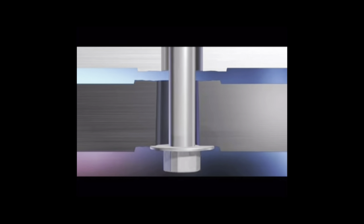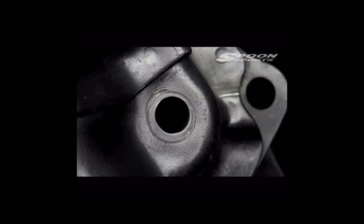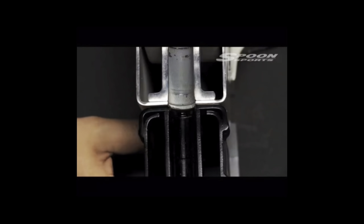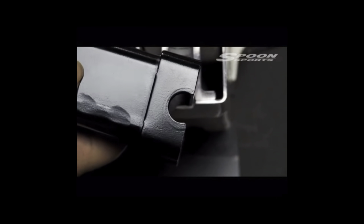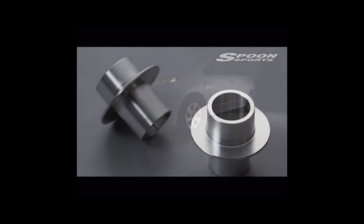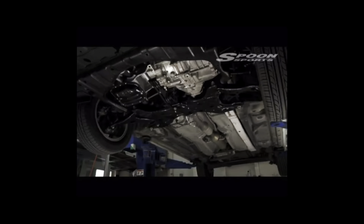Because of the size of the hole, the body shell and subframe are able to move even when the bolt is in place. Looking at the pickup points from the subframe to the body shell, you can see marks as evidence that the two panels are significantly misaligned. Further evidence shows that when the subframe is taken off, you can see the bolt is tightened with the hole offset, making it impossible to have an accurate geometry setup. The rigid collars wipe out the spring effect by giving the mounting bolt an even surface to bite into. The collars are constructed using a special aluminium which is tapered, and when fitted and torqued up, the metal spreads to form an even surface and contact face, making the bolt hole a perfect fit.